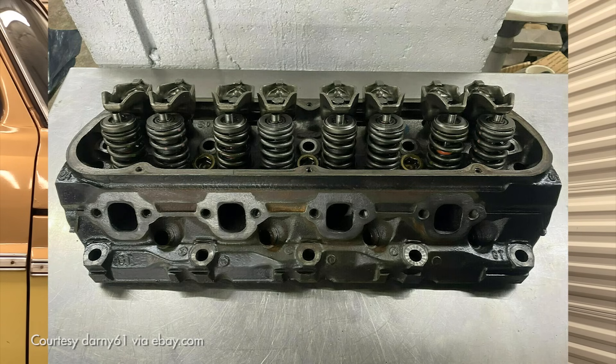What about the GT40 and GT40P heads? With the GT40, you get a 1.85 intake valve and a 1.54 exhaust valve, but you pay a penalty because it is a larger 66cc chamber. If you can find a set of GT40s, they're a really good head to start with for someone building a car that wants to appear stock but make a little more power. Average horsepower gain from these cylinder heads is usually around 20 to 40 horsepower — not bad for bolting on a set of stock-style heads, especially if you're already rebuilding your engine.